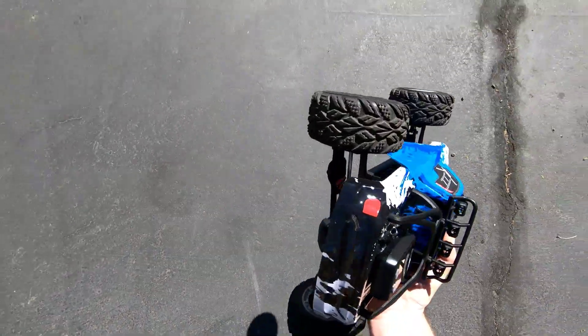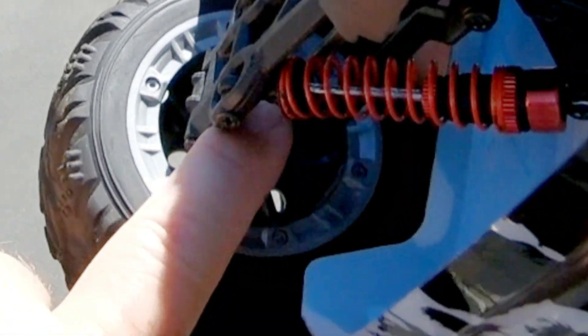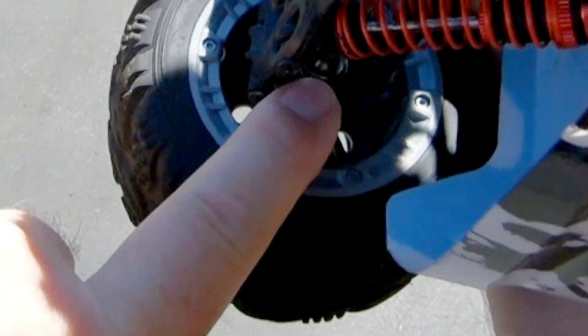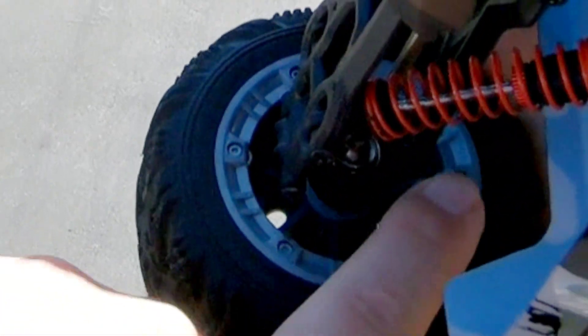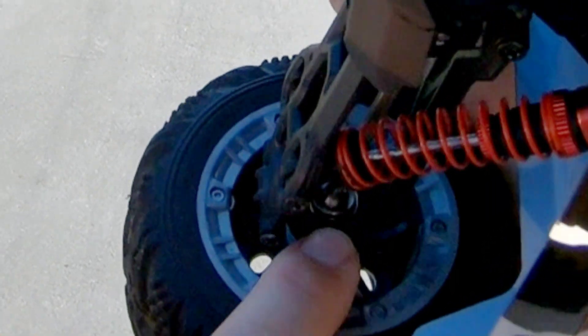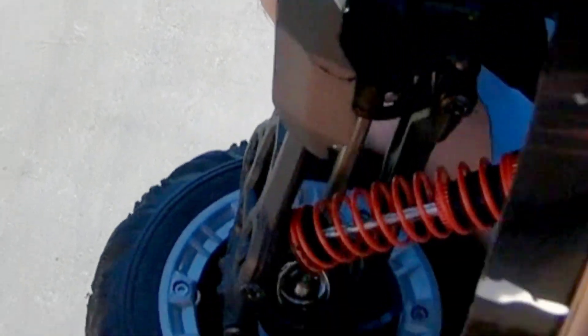Something got in the back wheel here. I wonder — see that pin popped out there. This is one I forgot to go and do. I'll be right back guys, let me pop that pin back in there and loosen these up. That's what I'm talking about — don't over-tighten these A-arms or it'll pop that little clip out and then it'll hang up. So I'll be right back.